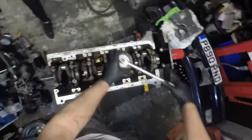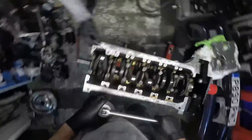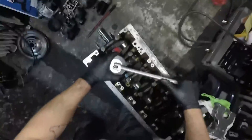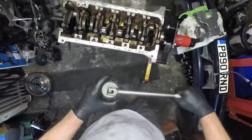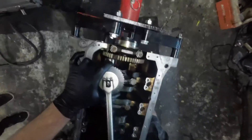Working from the middle outwards seems to work for all sorts of other stuff, so I went with it. As I torque up these bolts, I get some red marker ink - it's a bit like nail polish but this stuff is actually meant for doing this job. I just mark up each one of these bolt heads once I've torqued them. That way I'm never going to forget one - I know what I've done and I'm not going to miss anything and regret it later down the line.